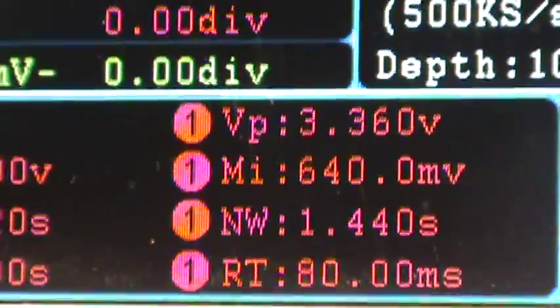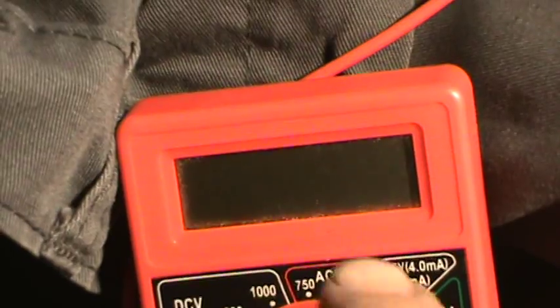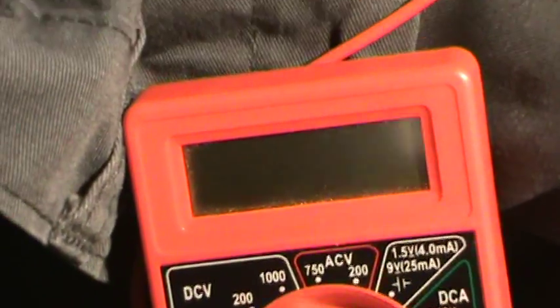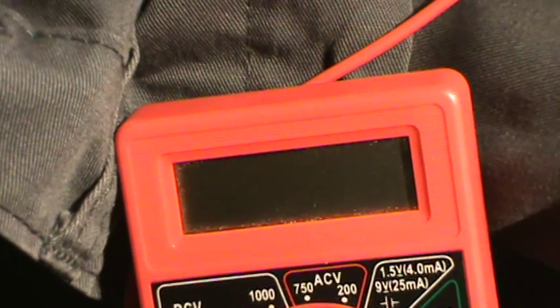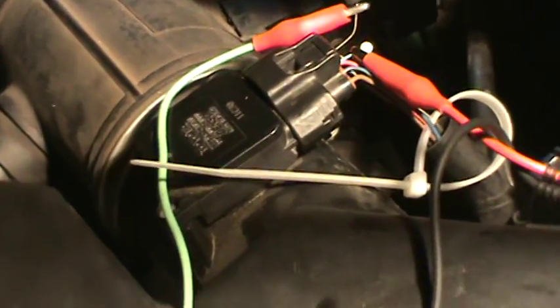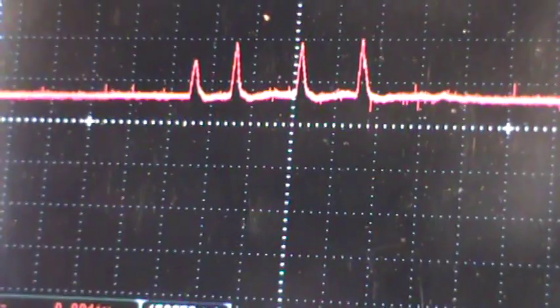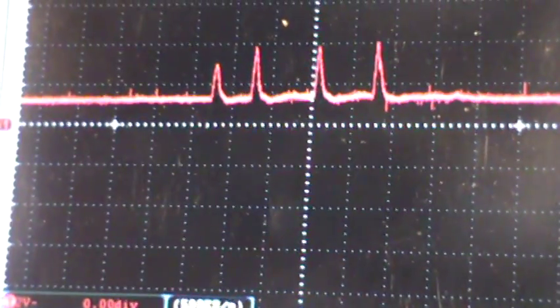Voltage peak 3.36. If you're using a multimeter rather than a scope, you're going to see the minimum voltage and then you might see a flash of 4 volts. If you have a better multimeter, you can set it to min/max and you'll be able to capture the minimum and maximum voltage. Take some deep snap throttles hooked up to the mass airflow sensor — you want to make sure it's going to hit at least 4 volts, because that's about the maximum airflow you're going to get. Thanks for watching — comment, rate, and subscribe.